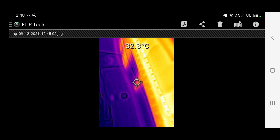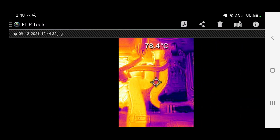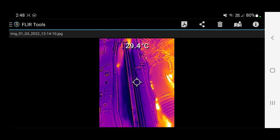This is a blocked radiator on a Pulsar — as you can see the top line of the radiator is flowing, but further down we've got a lot of cold spots in the radiator. Here's another angle of it. This is that same Pulsar but with a blocked heater core — as you can see we've got a red hot hose on one side going in and dead cold on the other side.